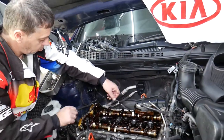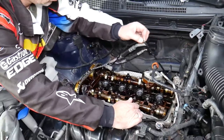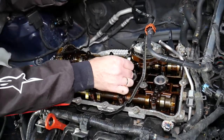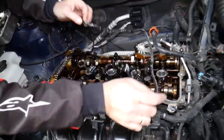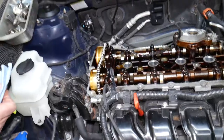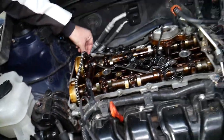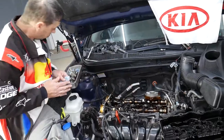Pull everything out — you also have the gasket for the fuel pump assembly. If you need to buy a new gasket, we'll put the link in the description. Clean everything thoroughly and apply a dot of silicone where the cylinder head meets the timing cover — on the front and back side. If you want to see torque specs, we'll have that video on the channel as well. Reassembly is basically the reverse order of disassembly. Thanks for watching and see you next time!